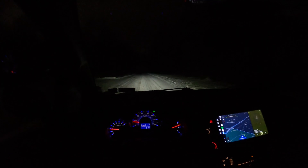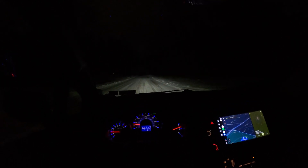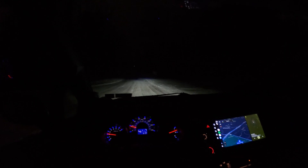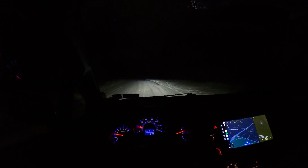With the LED, the chipset is integrated into the projector and you have that little purple hue you can see on the road. The cool part about the bi-LED projector is that the LED chipset projects the light into the projector, and then there's a solenoid that flicks the cutoff bracket up and down, allowing it to go from low beam to high beam.